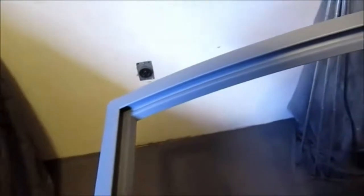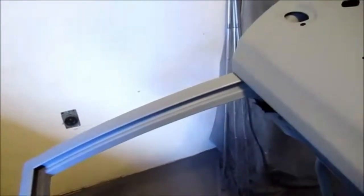And the window channels. Now when I sprayed the doors, they were upside down. The part of the window channel that was painted was the bottom half, which now that the doors are right side up is the top half. So when I turned the doors right side up the way they are now, and I sprayed the window frame, I was also able to get the other half of the window channel. Now the window channels will be covered with the weather stripping anyway, but at least now I'm very sure that I won't have a rust problem since it's fully coated.